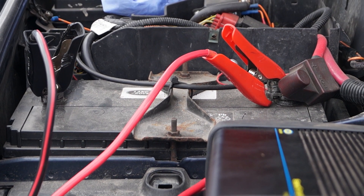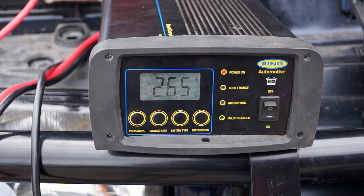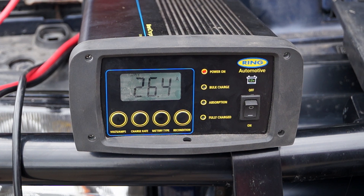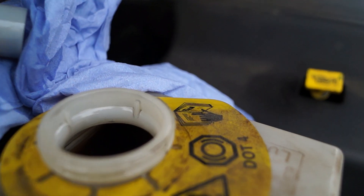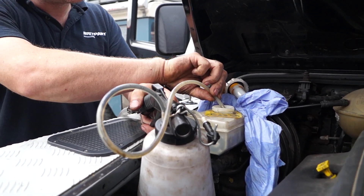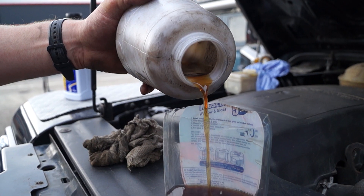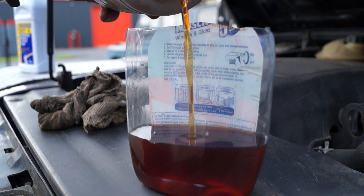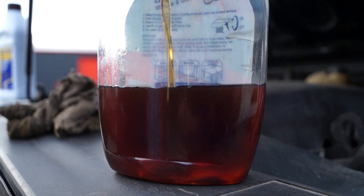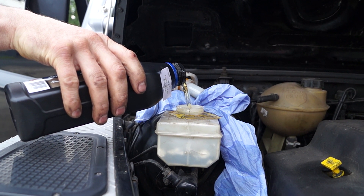It's worth noting you'll also need an external power supply or a very well charged battery — or two batteries — since the ABS modulator takes a fair bit of power. You can see at the top that the condition of the fluid is pretty bad. Steve has a vacuum pump which sucks the reservoir fluid out, and you can see the amount of damaging elements in this brake fluid, especially if it's been in there more than two years. You only need to compare the color of fresh fluid to see the difference.